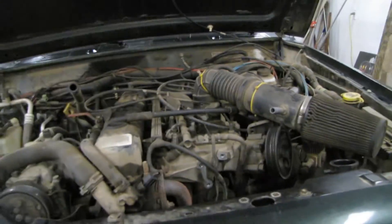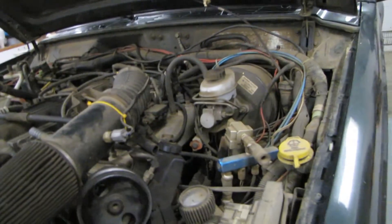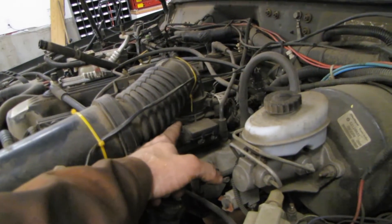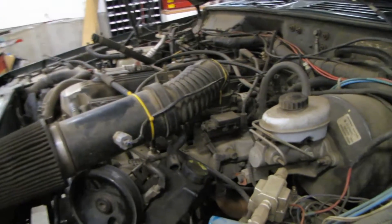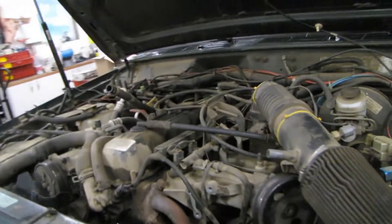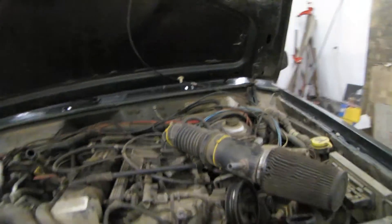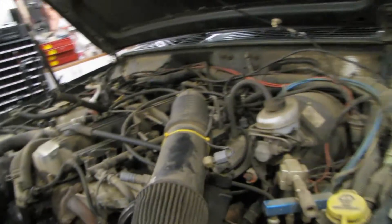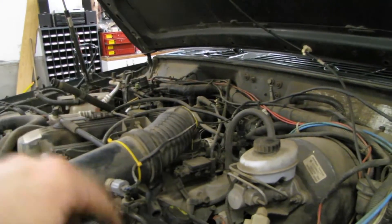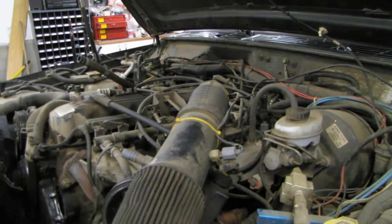And that's not necessarily a sacrifice either, because if your engine is tuned right and getting the right mixture, you get optimum fuel economy. As for the throttle body — I got a second core and bored it out. There's lots of info online about how to bore the throttle body: pull it off, remove all the electronic components, pull out the butterfly, throw it on a drill press and run a drum sander through it to open it up to match the diameter where it goes into the intake manifold, which in this case is through the throttle body spacer.